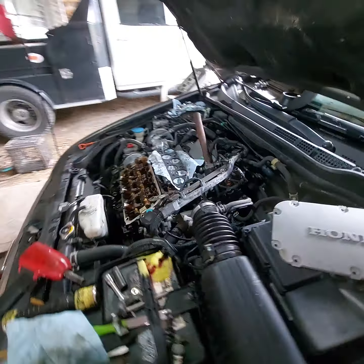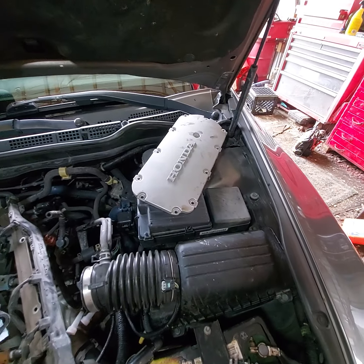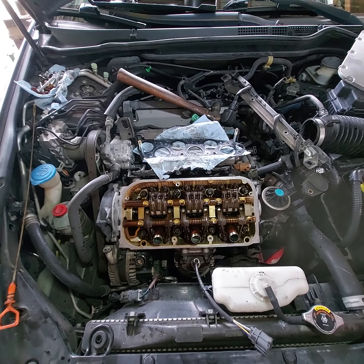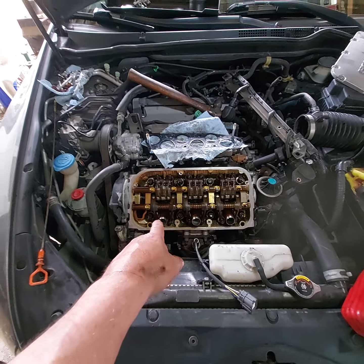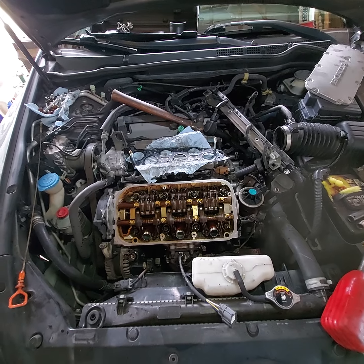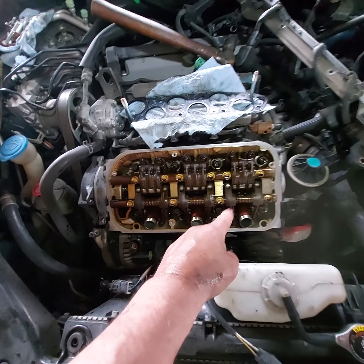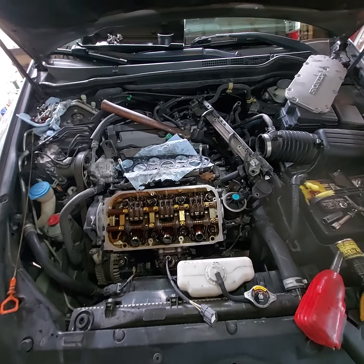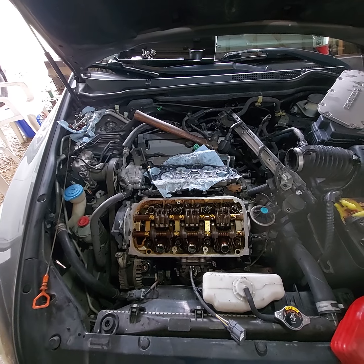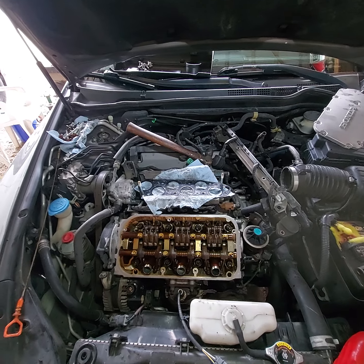All we've got to do is get a new plenum gasket set — it should come with a new piece to go underneath that top cover, and a new rubber valve cover seal with the three spark plug tube seals that go in the valve cover. I looked for any signs of loose rockers. There wasn't any noise, but I wasn't paid to go into all of that. I think it's had a tune-up in the last 20,000 or 30,000 miles, so it should be good to go. We'll get the new seals and get it back together.